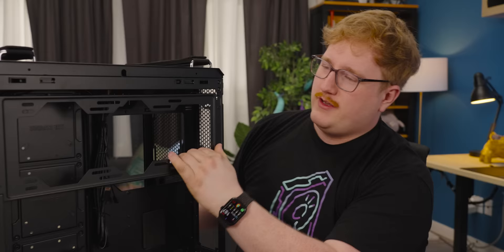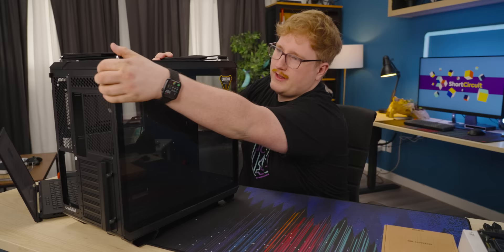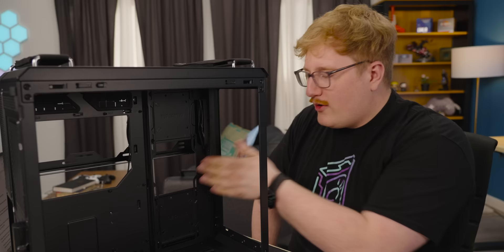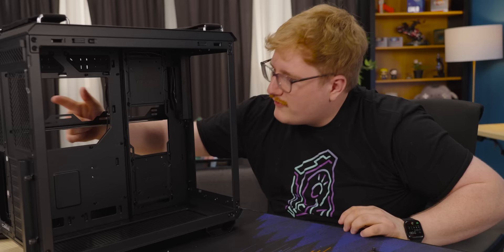I got some clarification on the dual-zone: you could put a second radiator in the back specifically for cooling your GPU — that's why they say you could have dual-zone heating and cooling. But if you're using an air-cooled GPU like we are, the GPU goes on the front. This is a nice-looking case. I'm a big fan of cases with glass in the front because of the access you get. It does hinder cooling somewhat since you don't have fans up front, but there's a trick: those SSD mounts can be removed and you can put fans there — or an AIO, or a distribution plate for water cooling. Very versatile. How many fans can you put in this thing? Thirteen fans!